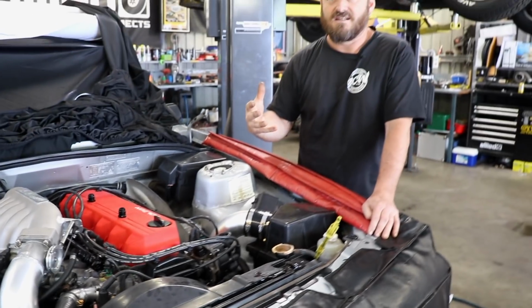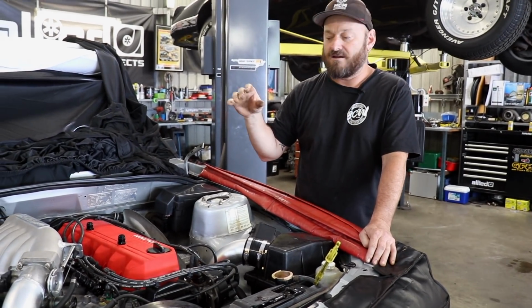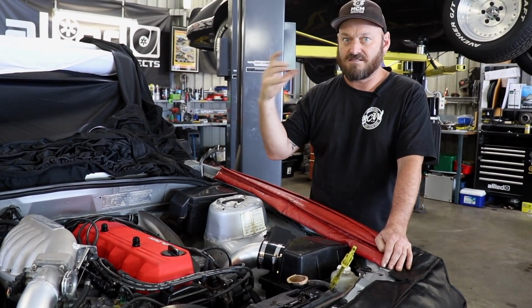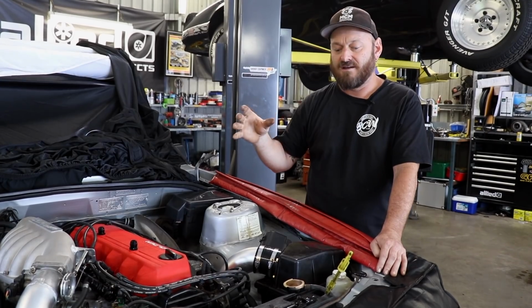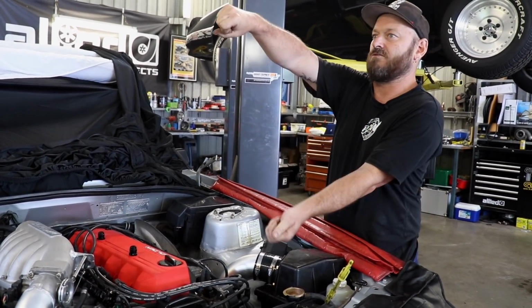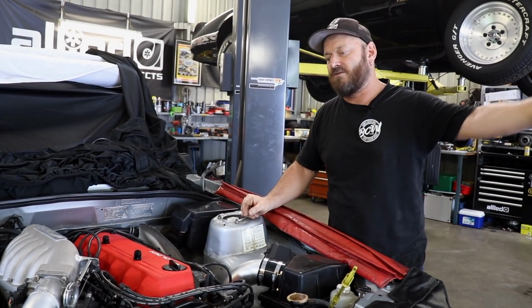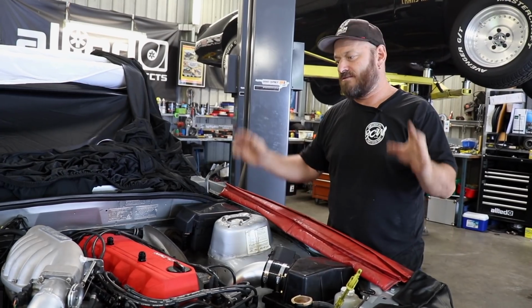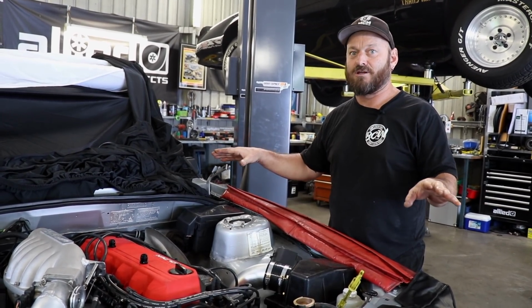There's a process that you need to take. Some engines are absolute nightmares to get the air out of. Subarus in particular, it takes a lot of time and experience to get those things to behave themselves. So please don't assume that you can just open the cap and go like this with some water, start the engine up and walk away, or go to Macca's or whatever. You can't do that. Changing the coolant, just changing it, is an hour-long job to do properly.